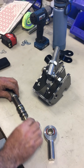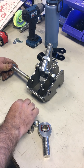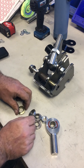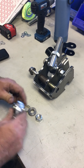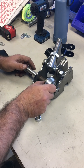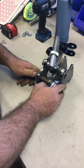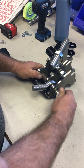To set up the spacing on the tie rod, we're going to do the same thing we did on the other side. We'll move everything off, come through here, and place the spacer in. Set up your heims with your misalignments — you can do that on your tie rod before you install so you're ready to go. This side was a little different in spacing, so we're going to put our spacer in the bottom as our washer, run it down in here with our grade 8 washer, slide that together, and that sets up our complete passenger side arm.